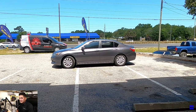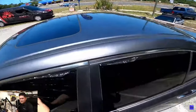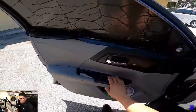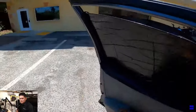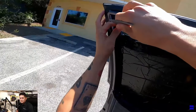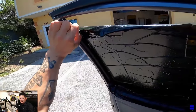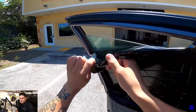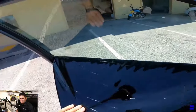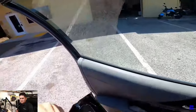From here, you're going to lay the car outside 15 to 20 minutes. After the car has been out in the sun for about 15 to 20 minutes, put your hand on it — if it's hot to touch, we're good to go. Turn the car on, crack the window, and get some sort of tool and start at the top. You don't want to pull all the way off all at once — just pull with it, because everything else dries up really quickly and sticks again. So just grab an edge and start pulling. If you're lucky, it pulls off with all the adhesive and the film.